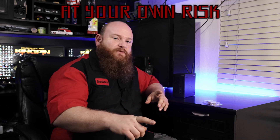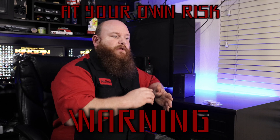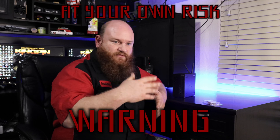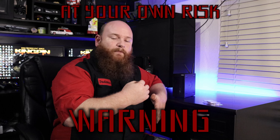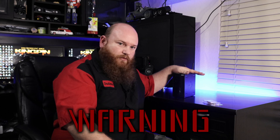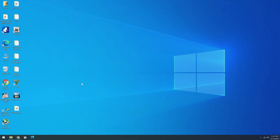Before any of that — word of caution. I am NOT responsible in any shape, form, or fashion if you break your motherboard. Many things can go wrong: you could flash the incorrect BIOS, the BIOS could be corrupted during download, or you could lose power. Since there's no BIOS switch on these boards for multiple BIOS, if something goes wrong, chances are the computer is not going to work anymore. However, if you're willing to try it and upgrade your A300 to run the new CPU without buying the new X300, keep watching.